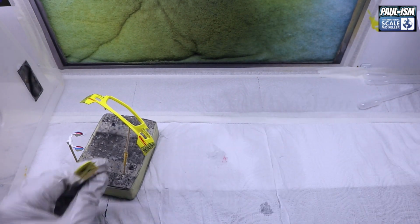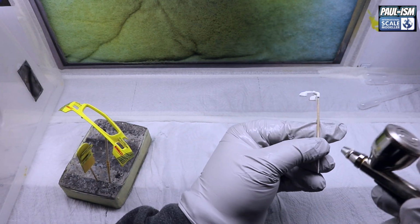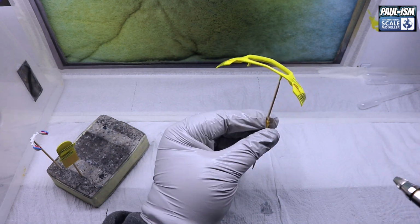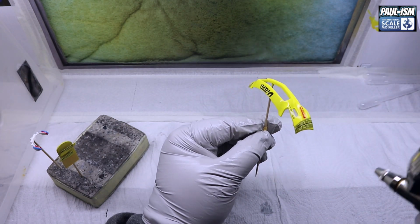Sterilely clean airbrush. This airbrush is only used for 2K. Nothing else. It's cleaned, left in lacquer to soak for a couple of hours, fully cleaned, and it's in the drawer, only used for 2K. That way there's no contamination, no issues, nothing at all.